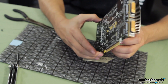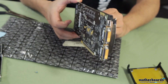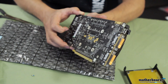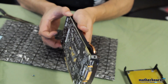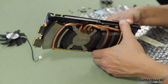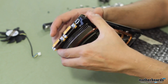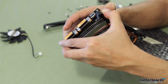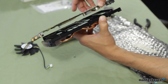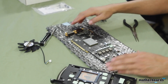Now here's the tedious part. You have to be very careful when removing and separating the heat sink from the card itself, because if you pry too hard you can end up either cracking the card or damaging the GPU itself. What I recommend is taking the card in one hand and the heat sink in your other hand and just gently rocking back and forth until you can feel it start to separate. Once you see the back end start to separate, then start working a little on the front. You can also try a twisting motion, and there it goes. And that is how you remove your heat sink and fan from your GPU.